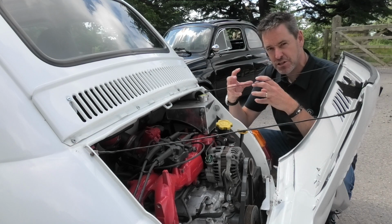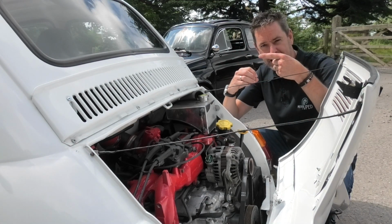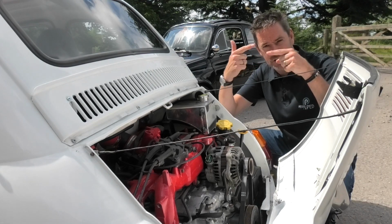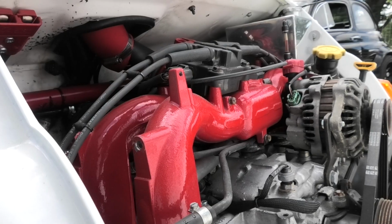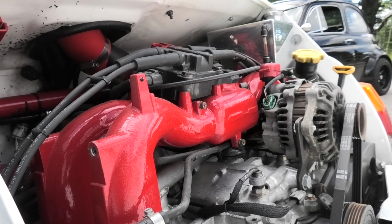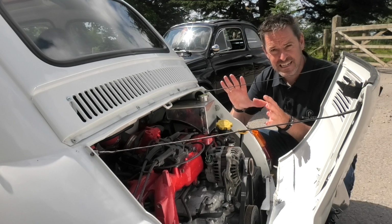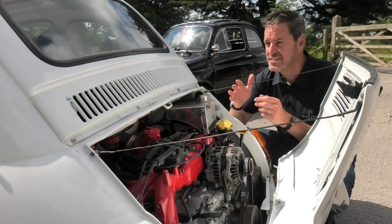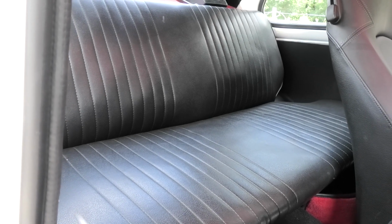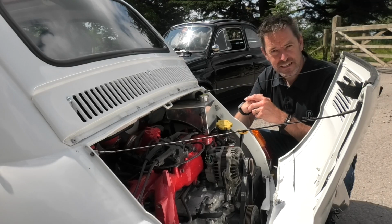So what they've then had to do is take a little crown and pinion adapter kit to basically take the output of the gearbox and, if you like, reverse its direction of rotation. So the car's now got 5 forward gears and 1 reverse gear, and I'd never even thought about that being a problem. The packaging of this is quite something as well. The gearbox is effectively sat underneath the rear bench seats, which really now are just a parcel shelf. There's no way a human being is going to actually fit in there.